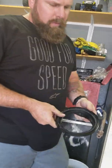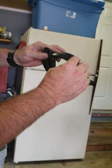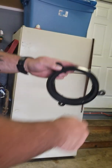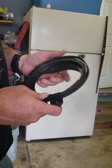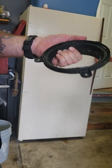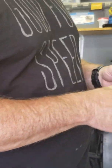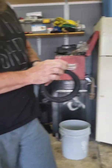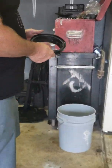This is what you're left with. When you do this on the front speakers, the body flange is kind of tapered so it aims up towards you rather than right at your leg in the door. There is an orientation for the front ones and for the rear too - they actually say 'up' with an arrow showing you which way to go. For the front ones, pay attention to the orientation: the flange is going to be skinnier towards the top and front where it mounts, fatter towards the bottom, which pushes the speaker up.